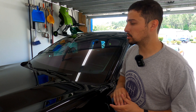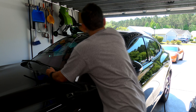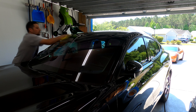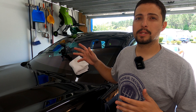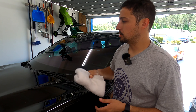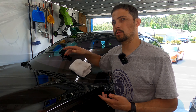Now the first thing I always like to do is of course clean the windshield. Clean your windshield because it's always good to put brand new wipers on a nice clean windshield. Now that we've got the windshield nice and clean, we're going to go ahead and dive in and see what we need to do. Always make sure you keep a rag with you just to put underneath the wiper arm — when you take the blade off this way you don't cause any chips or cracks to your windshield.